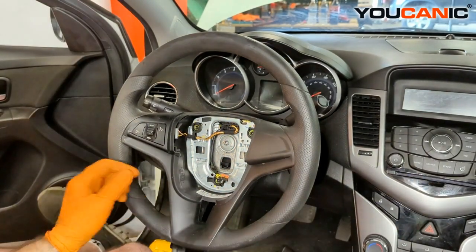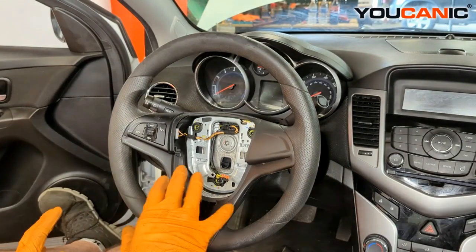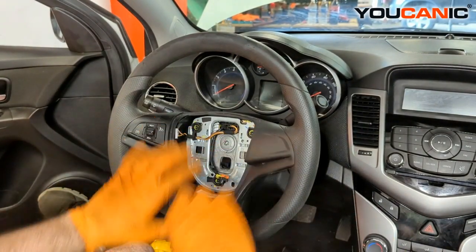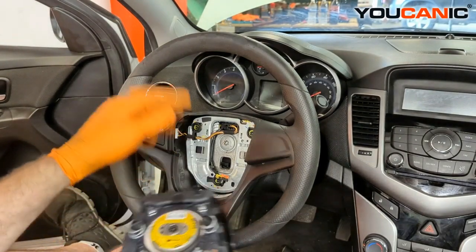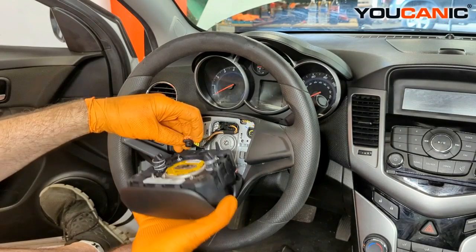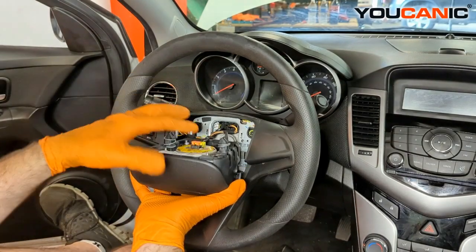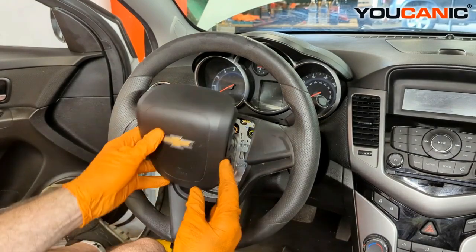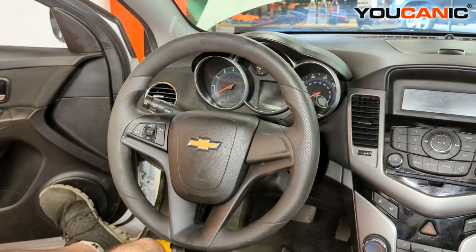It's been tightened and snugged in there. It had some thread lock on it, which is why it was resisting a lot going in initially. But it's in there and it's tight. The last thing when putting this all back together — we're now ready to put our airbag back on. Remember, electric is still disconnected for this process. Line up the connector, press it in, press the double lock in, and then line this up straight and press it straight on. That is the way you put everything back together for your steering wheel, airbag, and all of those components — in the order in which you took them off.